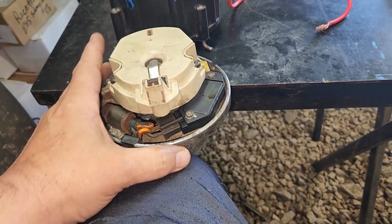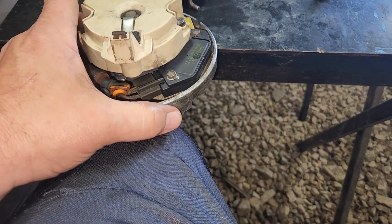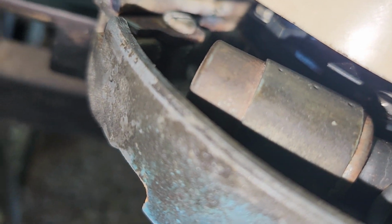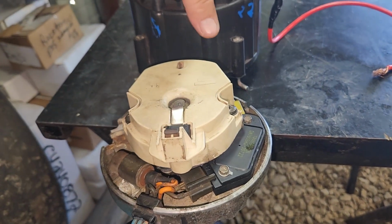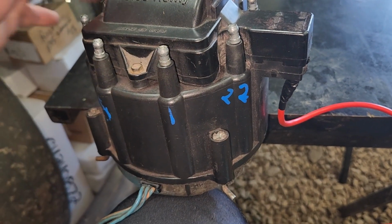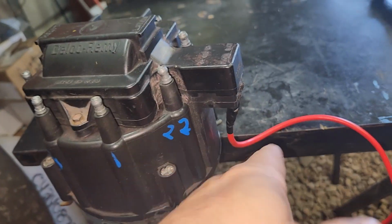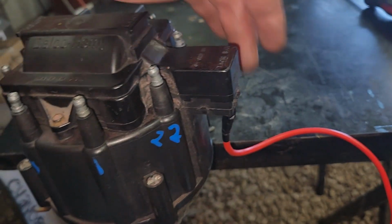So we stab the distributor with the nut down here loose that clamps it down. We turn this base plate until it lines up with our rotor, which in turn is going to have our magnetic pickups lined up. I know you can't really see in there, but trust me, they should be lined up with what we did before. And we put the cap on the correct way, and then we lock those down, and then plug this piece up in here. Get your key-on hot wire, the one that stays hot while you're cranking the car, goes there.